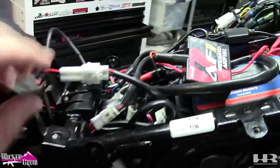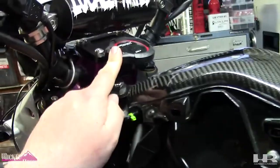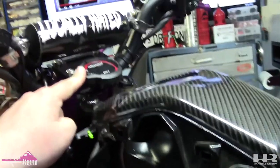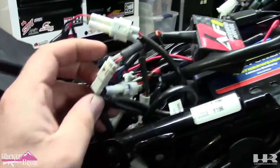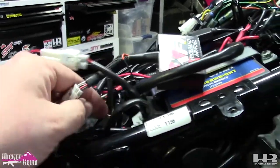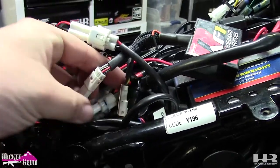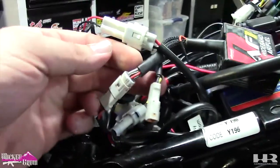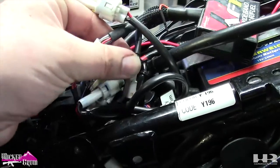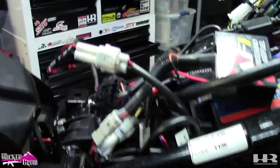So that's that. I run the DJ1 gauge, which is awesome. I use it to display my air fuel ratio if I'm using my phone for GPS. That will just run and it simply plugs directly into the A-Racer or AF1. And then there's another plug here, plug it in. Again, these two ends are opposite. You cannot mix them up. One is for the DJ1 gauge and one is for your harness. I'll plug that in later.